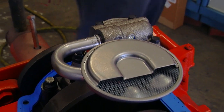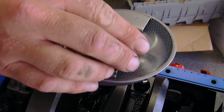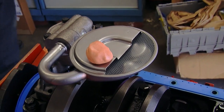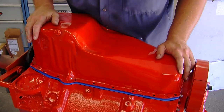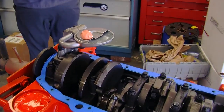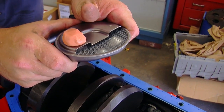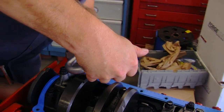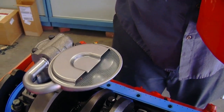The way you do this properly is to install the pickup partway into the pump so you can still rotate it a little bit, then put the pump on the rear main cap. Set your gasket on the block and set your oil pan on. Depending on the type of gasket you may want to torque the oil pan down if the gasket is going to crush a lot. In this case the Felpro gasket is steel core so it doesn't crush much, so I just gave a firm push on the pan to make sure it was pretty much where it was going to be. We did all this with modeling clay placed between the pickup and the pan.